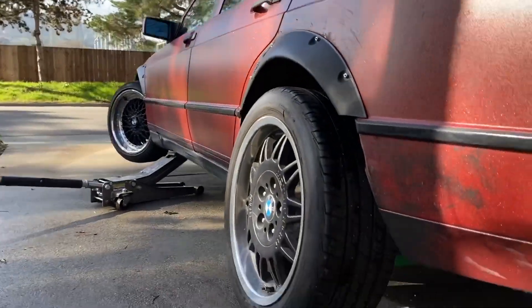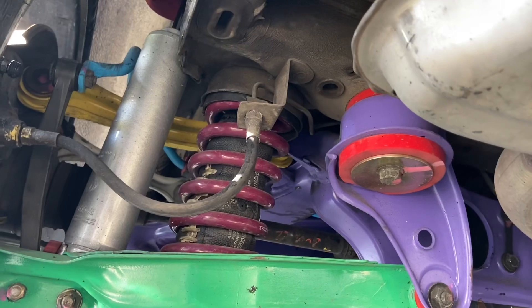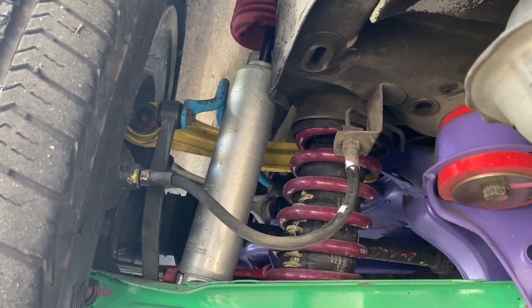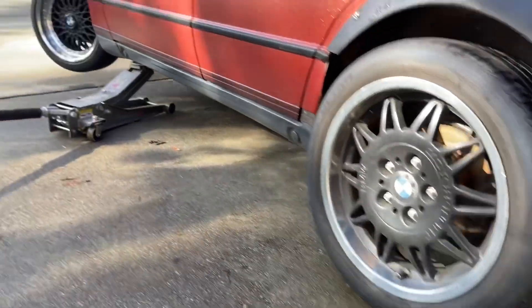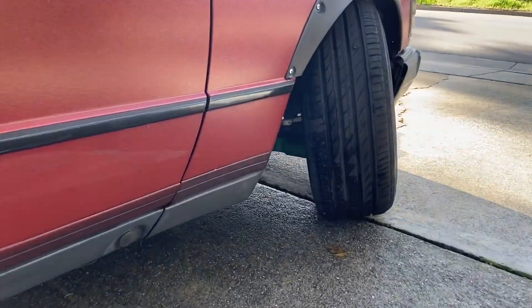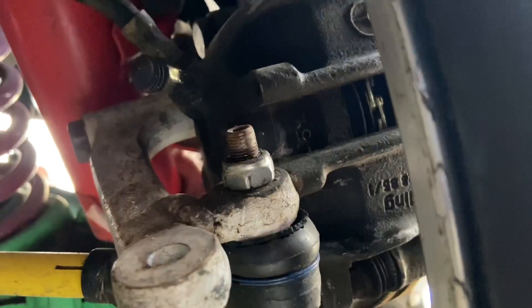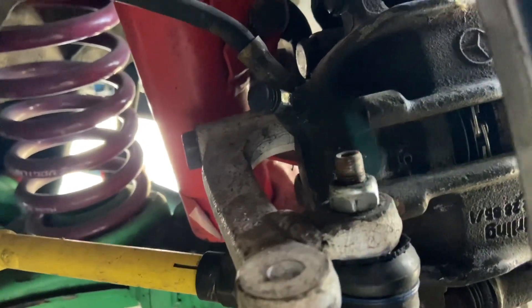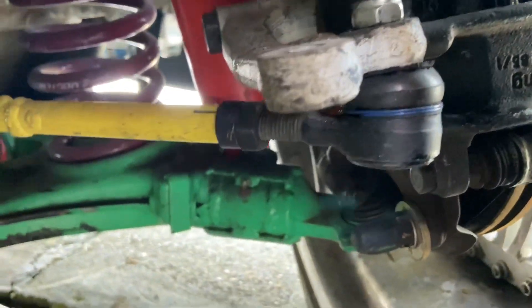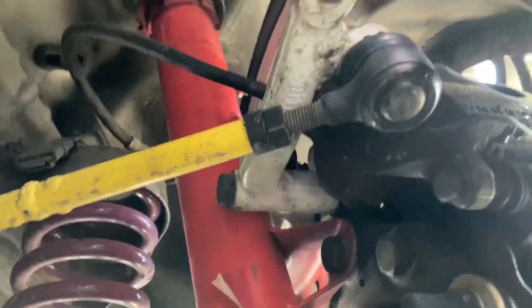Since the car is up, I'll show you the rear suspension setup. These are some Ford Ranger rear shocks — dampening adjustable — and some coil springs with footballs inside them to make it better dampening. Here's a look at the other side. You can see how I adjust it to get more angle — you just weld in a tab right there and you have to shave your caliper so that it doesn't hit. Those are the E36 coilovers again — you've got to weld in those joints.